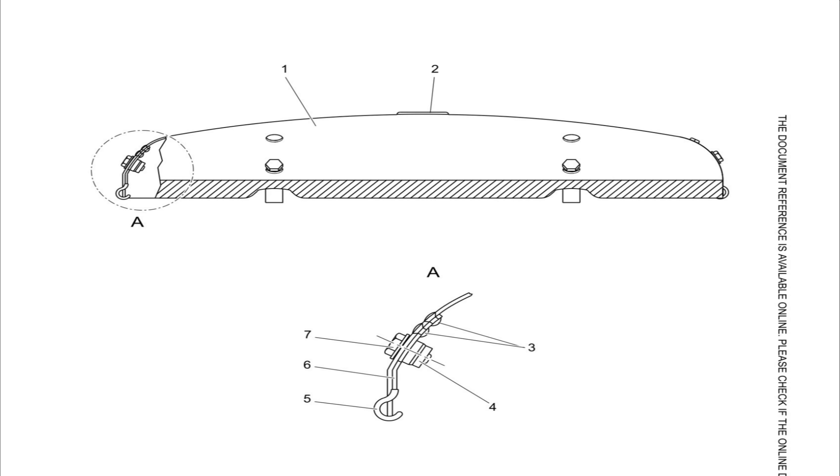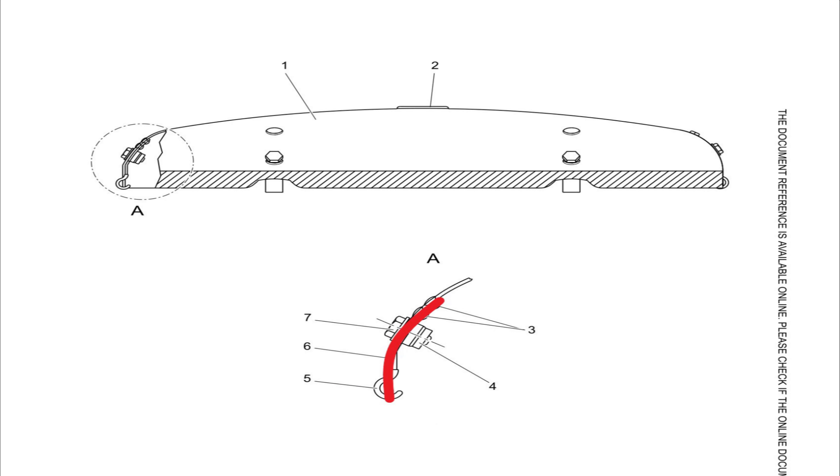You can get a rubber mallet and tap the screws that are sticking out — it'll help pop the whole flange out. Those screws just cinch down the tightening piece; they hold on the retaining spring, and when you tighten it down it pulls the retaining spring out to hold it inside the hub body. If you take the screw out, there's nothing really holding that spring in except a rivet. The retaining spring can get twisted and then it's really hard to put the fairing back on, so just keep that screw in and loosen it up a lot.